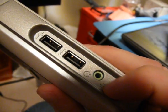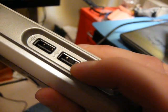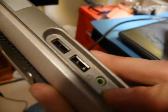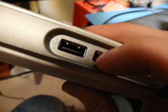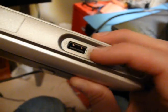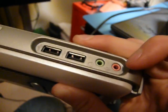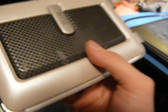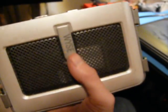But there's a bug in the BIOS where if you boot from USB, not only does it disable the IDE controller, the bit rate of the USB while it's booting is abysmal, so it takes several minutes to load a tiny kernel and start booting. But once it boots, it's fine. But I don't plan on using this in my car. I haven't actually decided on what to do with this one, but it runs on 6 watts, so lots of applications there. Anyways, thanks for watching.